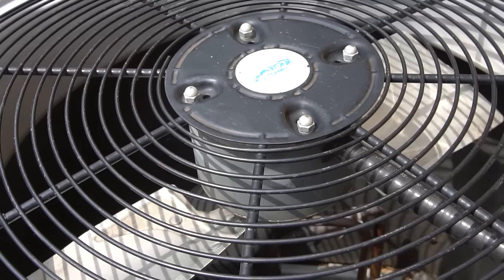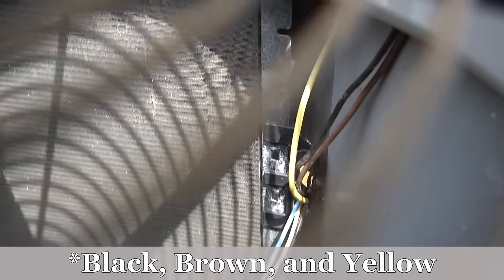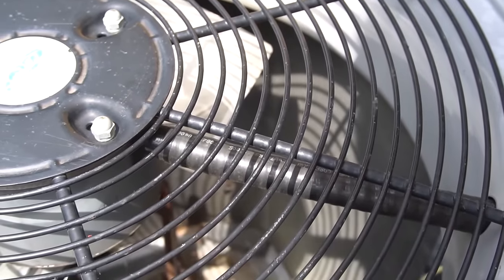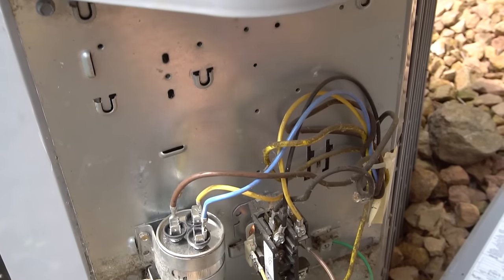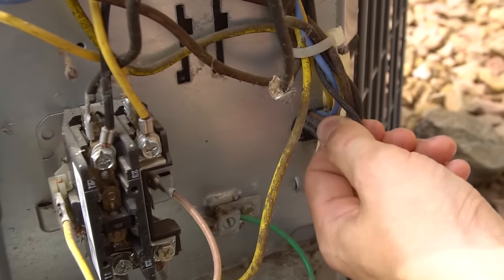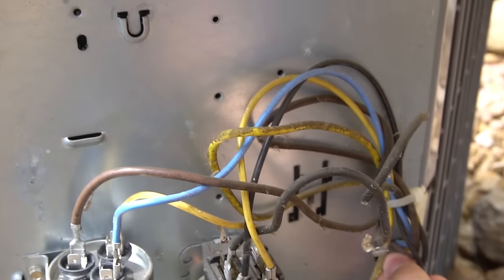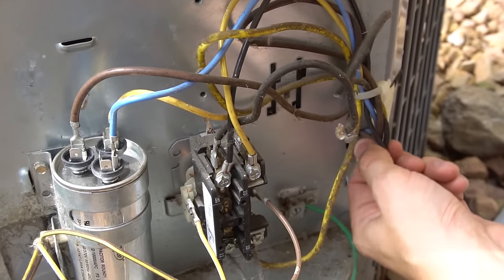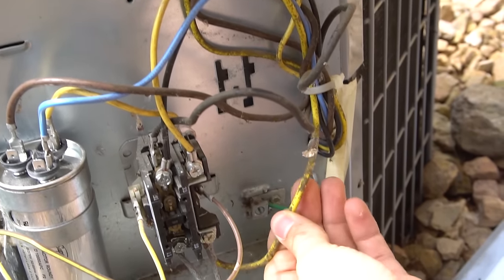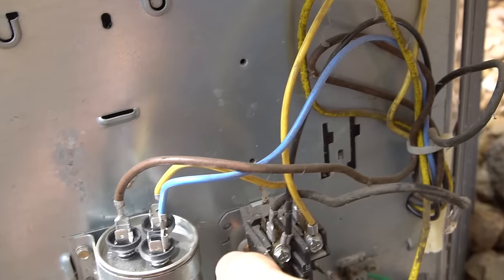The wires go through here, and if you look on this side you can see what color the wires are. We've got a black, a brown, and a white that come from the condenser fan motor — so this motor is a three-wire motor. If you're not sure which wires go to the condenser fan motor, just pull on them and look from the top to make sure you've got the right ones. I traced my wires: yellow, black, and a brown that goes to the dual run capacitor.